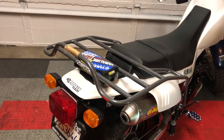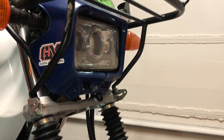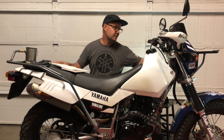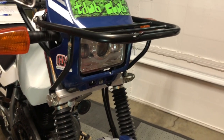For moto camping, on the rear I'm using the Cycle Racks rear rack, and on the front I'm using the Moose Racing front rack. What I like about the Moose rack is that it sits above the headlight, whereas others sit below it. That way, when I'm riding at night in the woods — and I do ride quite a bit at night — I can actually use my headlight. Other companies have lower racks because a lot of guys use this bike for hunting and hauling equipment, and they're typically not riding at night.